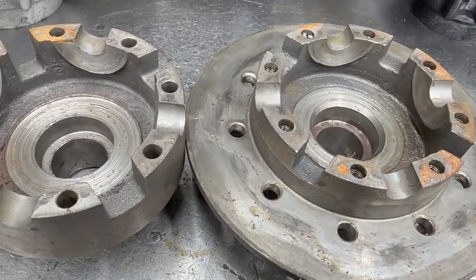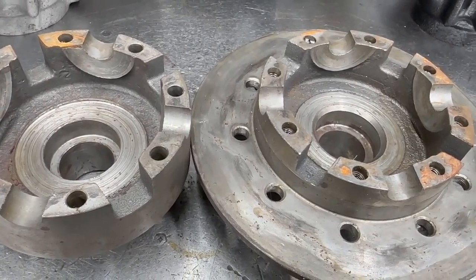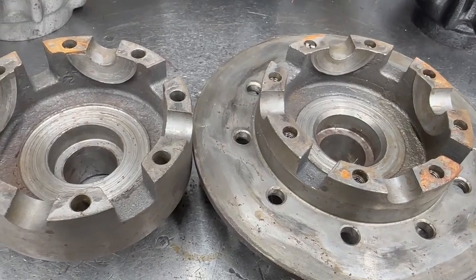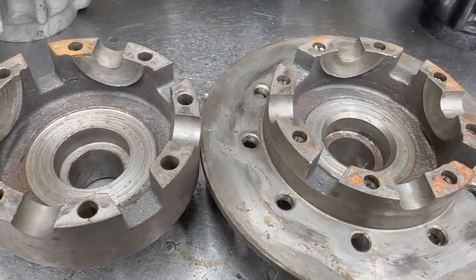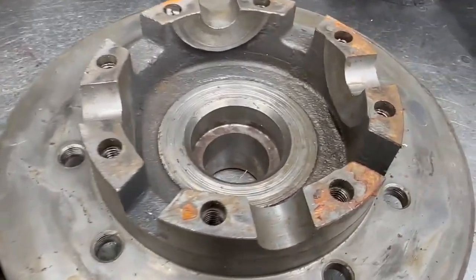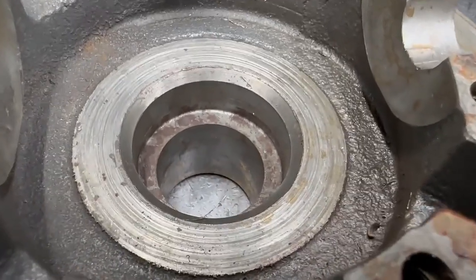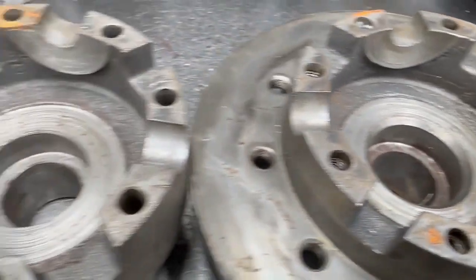When you're looking at these short nose casings and short nose four-pin diffs, you've got to be careful — different varieties: 16mm, 18mm, with and without thrusts. Thrust washers are designed to actually take the wear and stop this sort of thing happening. Absolutely crazy.